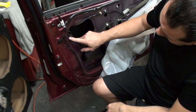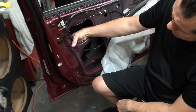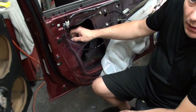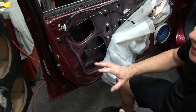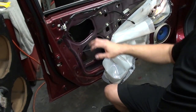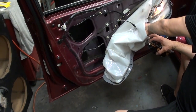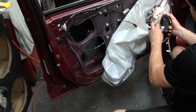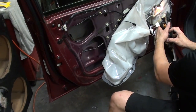I'm going to lift this up — there are two clip-like hooks. That's the cover for the whole door lock assembly. What you want to do is lift it up and then push it through. Before we go and take that out, I should have mentioned this at the beginning: make sure your window is rolled up. We want to have enough room to pull that assembly out of there, so I'm going to plug the switch back in and roll the window up.